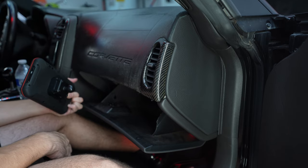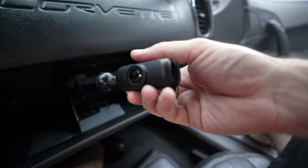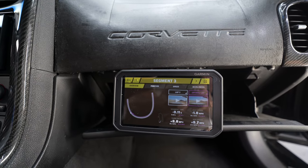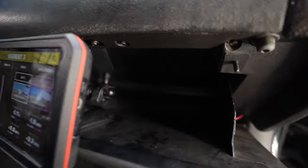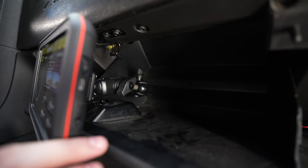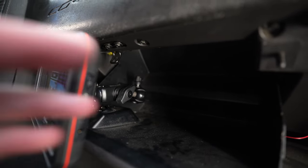The wiring for the camera can run up the dash, up the A-pillar, and through the headliner down to the windshield — less wire showing overall. I noticed that with just one joint the Garmin would be too close inside the dashboard panel, but the kit does come with two joints. So I'll mount both and that should give enough distance for the Garmin to sit comfortably just outside the glove box. There it is — nice and mounted up just under the glove box, with flexibility to adjust the arms.